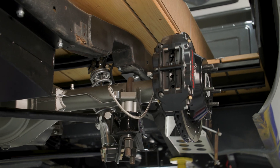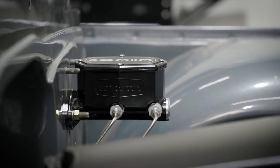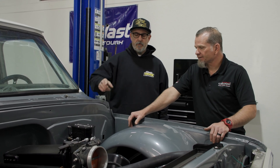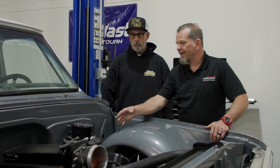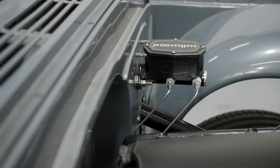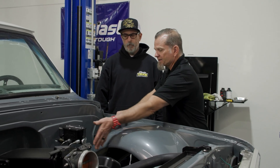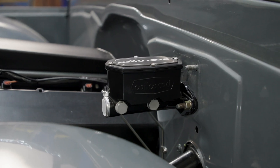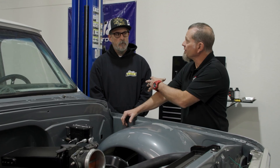Mike, we've talked about the brakes and what we use and why. Let's bring the truck down and talk about the master cylinder. So what we talked about and what we chose was our compact tandem — it's a newer master cylinder for us. It's a different shape; I'm used to the big oval. It's an inch and a half shorter than our oval top, so in a lot of applications it gives a lot more room, especially for shock towers and some later model cars. We decided on a bore size master cylinder that was going to be perfectly matched for the brakes and for what you're doing.